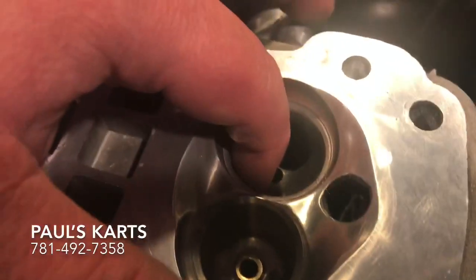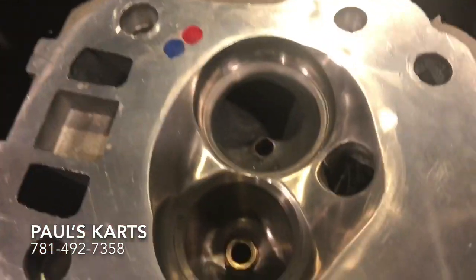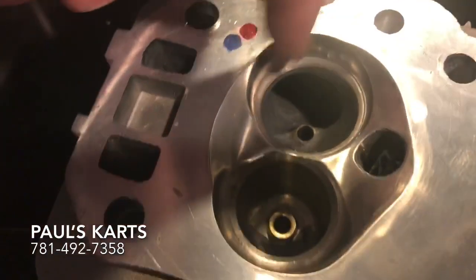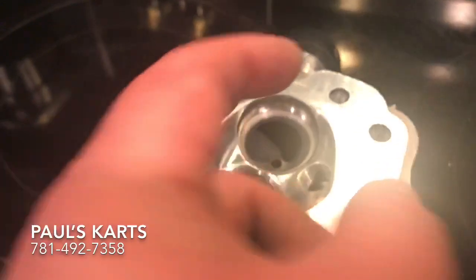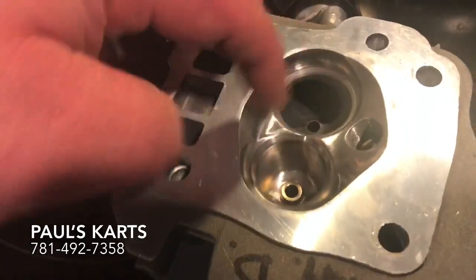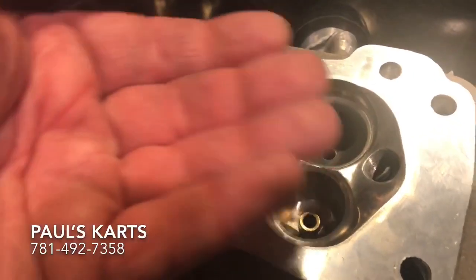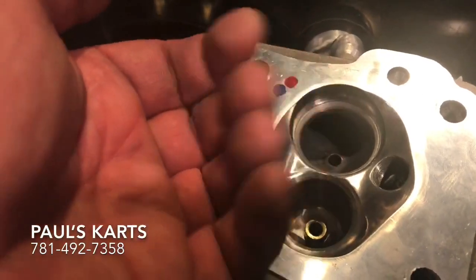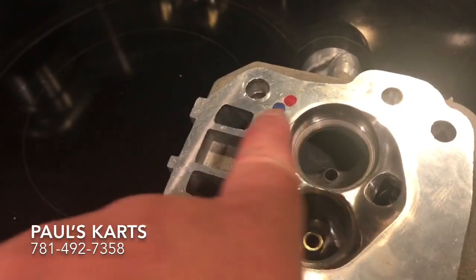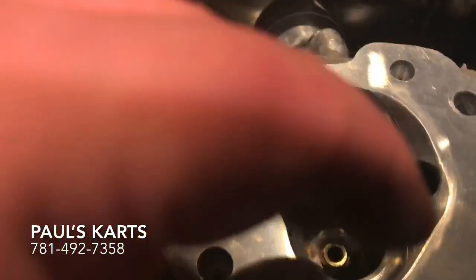Any part of it — you can never invert a bowl. If you put a straight edge down and run your finger down, and that bowl actually comes down and bellies out fat ways down there, you've inverted the bowl. What happens is the air has to come up, then it rides that inverted corner and it's coming the wrong way — it's angled at the valve stem instead of sliding up a hill and coming out. It actually reverses the flow and points it towards the center of the valve, and that really hurts the flow.